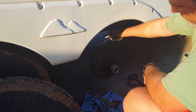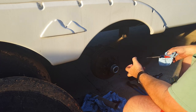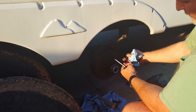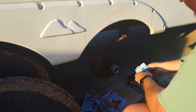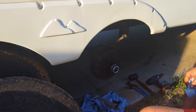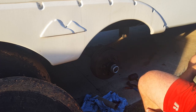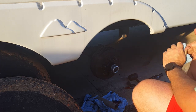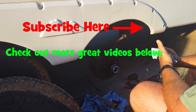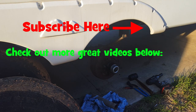This little zerk goes all the way back, and that's why it takes a while for the new grease to start coming out — it's got to go all the way back and then push all that old stuff out toward the front. Pretty good design. If you get this kind, it shouldn't hurt to do it every year — it says so. Since it's not that hard, it would be a good maintenance job to do every year. As always, thanks for watching and we'll catch you in the next video.